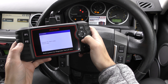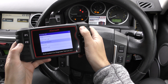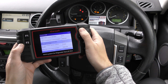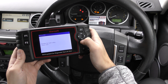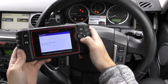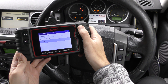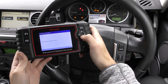We erase the codes and the airbag light flashed for a bit and has come back on. I suspect once we restart the engine or completely come out of the airbag system it will go off. Let's go back into Read Fault Code, clear fault memory again — it's flashed and come back on. We'll come back to that. For now I'm going to go into the ABS system.